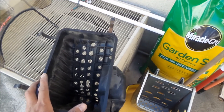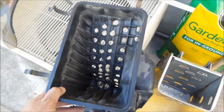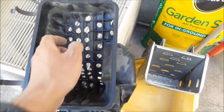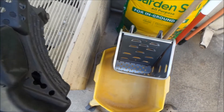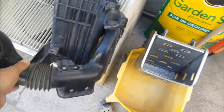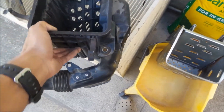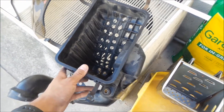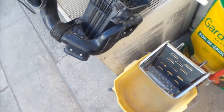So what I did is I drilled a crap ton of holes on it. I did this with my 1986 Toyota van too — I drilled the airbox because there was no cold air intake stuff for that van. I drilled the air intake so it would get better airflow, so it basically becomes an open element air filter. The good thing is it still has a snorkel here, a cold air snorkel, so you get cold air in there, though it'll suck air from the accessory bay too. But the accessory bay doesn't get hot in the Previa because the engine is under the van.